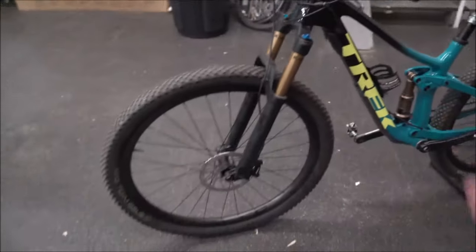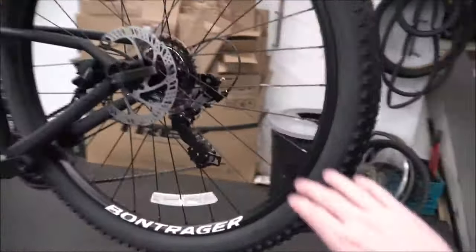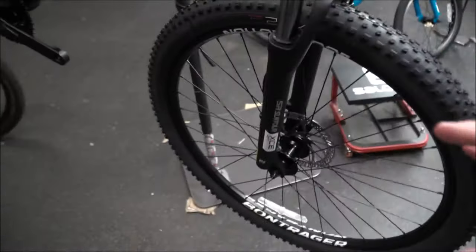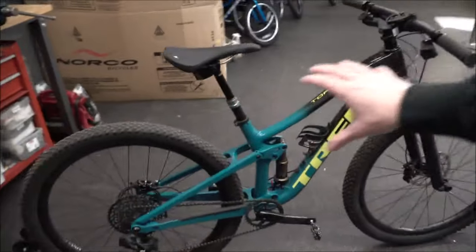It does have the carbon fiber rims on this one. So carbon fiber in comparison to an aluminum one, you're saving a lot of weight when you go to carbon fiber. Two, you get a lot of stiffness in the torsional twist of it. So what that means is when you're actually turning the corner, there is literally flex in the wheels. It turns, it bends, it morphs. With a carbon one, you're not gonna get that.